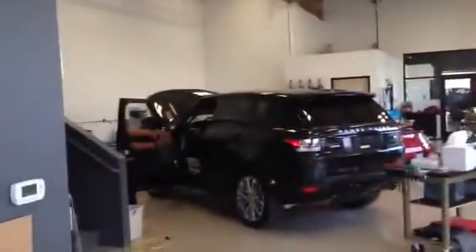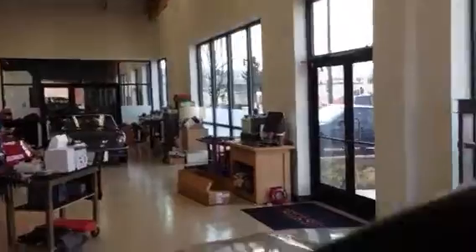Here's our new facility for those that haven't seen it — a little messy right now, but we're kind of busy. So I'm going to pop on in here and show you this. Here's the iPad Air. It's a full size iPad and the customer wanted the full size in there — he didn't want to do a mini. This location right here previously was vents, and then we had a CD player and radio controls down here. The radio faceplate itself has been relocated to the back, to the trunk, so we can change the clock on the instrument cluster, because if that's removed from the vehicle completely, you lose that feature.